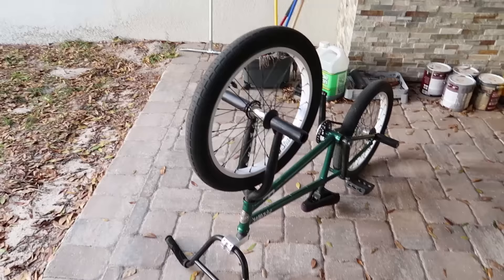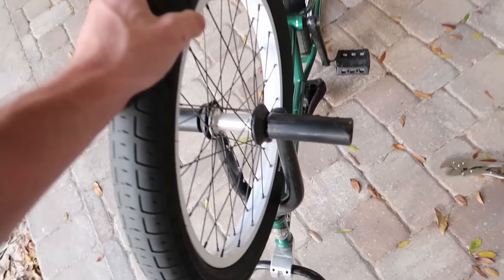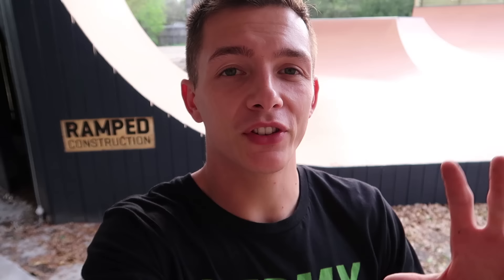Now if none of your friends have a compression cap you can borrow, or if you're stranded at a park and want to tighten your headset, there is a way to do it without one, but it's kind of difficult. You could flip the bike upside down and try to put pressure on the forks by standing on them, but it's kind of difficult to get even pressure so you still end up with a little bit of a gap in the headset. The best way I was ever able to do this was with the bike right side up in my dining room — I stood on the handlebars and pushed my hands up against the ceiling to compress everything down and had a friend tighten it. Obviously not ideal, but if you need to get your headset tight without proper tools or a compression cap, it's a way to do it.